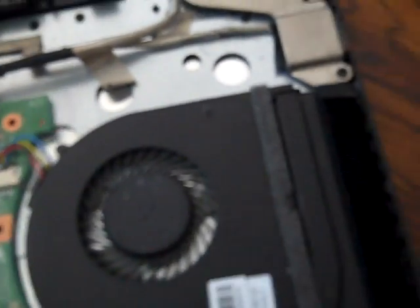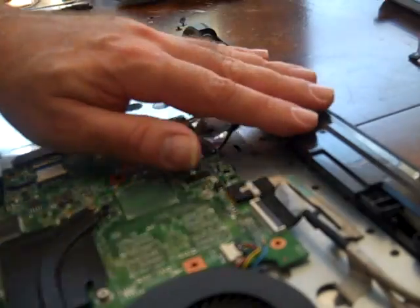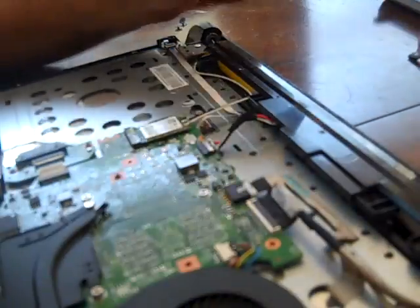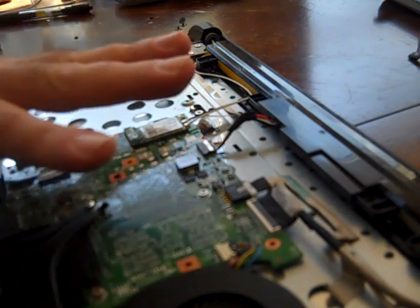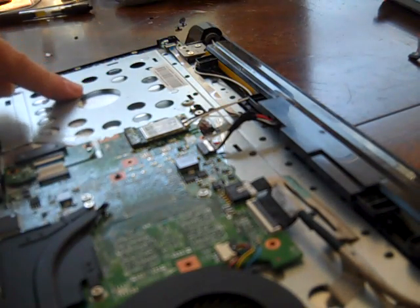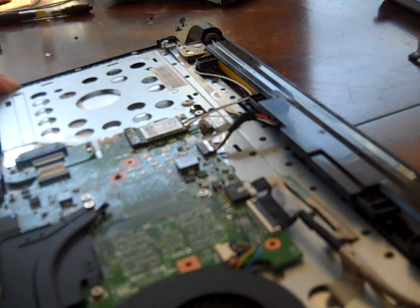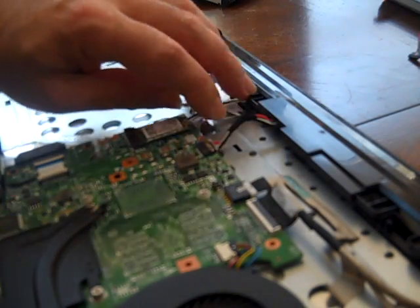Assembly is just going to go in the opposite order: put all the mounting screws back in, make sure that the laptop battery is seated firmly on all the mounting screws, and then reassemble, snapping everything together ever so gently. To recap: bottom screws, take off the keyboard, some mounting screws there, slide out the CD-ROM, more mounting screws underneath the CD-ROM, and then unplug the battery and plug the battery back in.